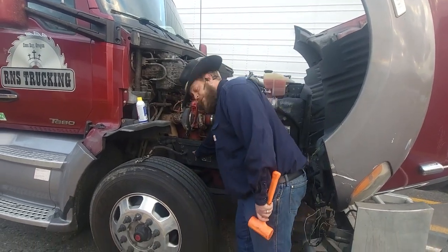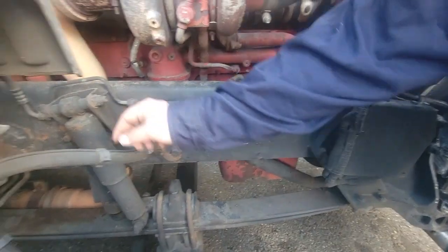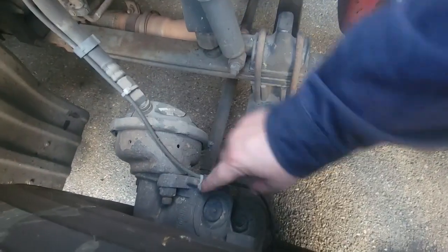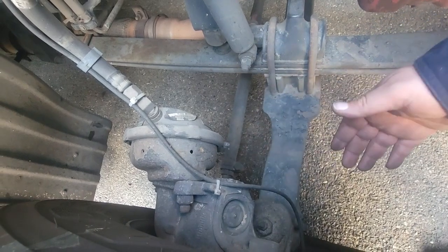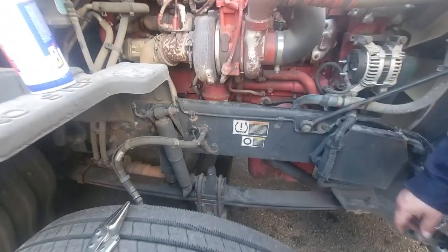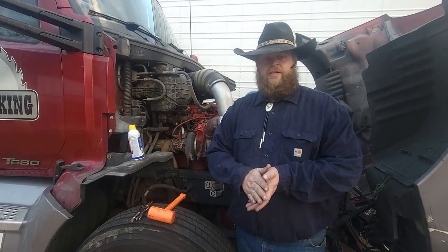They're relatively easy to work on and most of the wiring harness for your ABS sensors are inside the frame rails. You'll have to cut these zip ties — this is the wire for the ABS sensor clipped onto the air hose here, and there are zip ties down here holding it up out of the way so it doesn't get pinched, ripped, or get up into any moving parts. I've seen these cables get in between the slack adjusters.